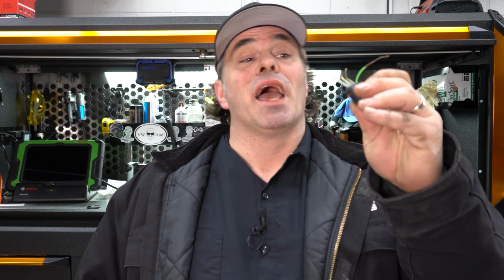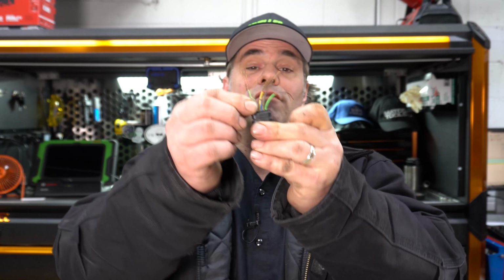Before I could diagnose the issue, which I still haven't actually, because it goes away, but because this is one of the wires that was important, which I have 12 volts on, by the way, it doesn't go away. But anyway, I had to fix this first, and I went ahead and just put a pigtail on it, because rather than depinning and repinning and all that stuff, put shrink tubing on it, I'd rather just not deal with this ghetto stuff. So if you're doing stuff like this, fix it right, depin it, or get a new connector,